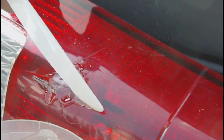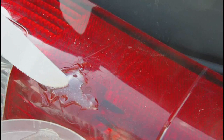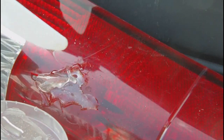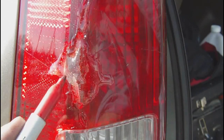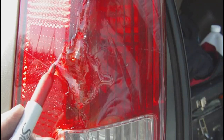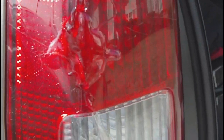I am almost finished filling in the holes as you can see. This will cure for about 15 minutes — a little bit tacky. I am going to take a magic marker, the Sharpie, the red one, and add it to the epoxy. As you can see, there is the color. See how it evenly matches the reflector? The next step will be to sand, and we are going to have to wait until tomorrow. There is the coloring.